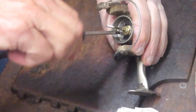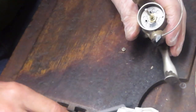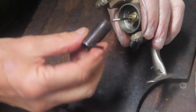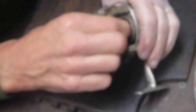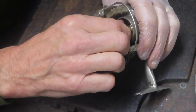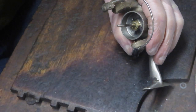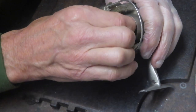There's a hold screw for the rotor nut, and then you need a deep socket. I have a 12-millimeter tool here that can break that socket piece, but you don't need the 12-millimeter tool — just grab a deep socket and use that. We're going to take this off again, mainly for cleaning. I did do a test on this.